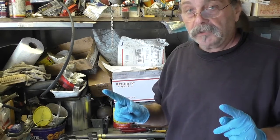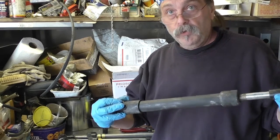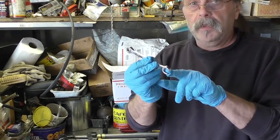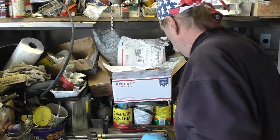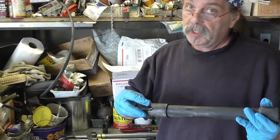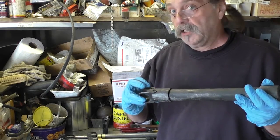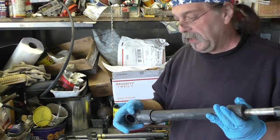So we're going to get into some details, and we're going to show you a couple of things about the cylinder. As I showed you before, the cylinder has 2 holes at one end. It's very important that when you disconnect these hoses that you use what's known as a flare nut wrench. They go all the way around the nut so that they don't strip the edges. Very, very important. The other thing that you want to make sure of is that these 2 holes are not stripped when you take them off, when you put them back on. You want to be very, very careful with these, because if you screw up these threads, the compression fitting inside will not work. It's a special flared fitting, and it has to be seated properly. If the threads won't tighten, if it's cross-threaded, they will leak.